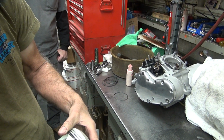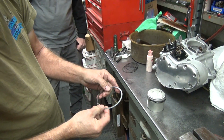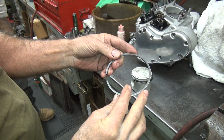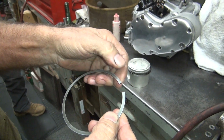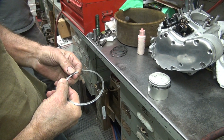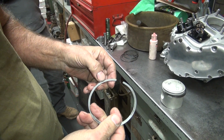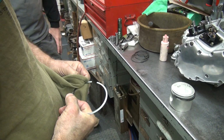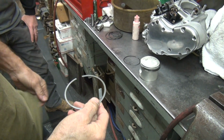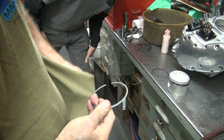The other thing is that you put grooves right here, like with chamfers, and that's detonation rings that mix up the gas above it and stops the detonation. They didn't do that though. No. They only got halfway in there. And better gas than 65. That's right. I think there's a mark there, isn't it? Don't see anything there. Might not matter in a second. It does matter because it has a chamfer on it. These are chamfered rings, so they're not just universals. It's another thing they did back in the day. They had pressure-backed rings. Stuff was better quality back then than now.